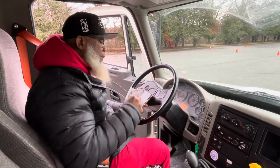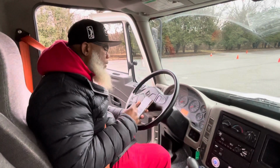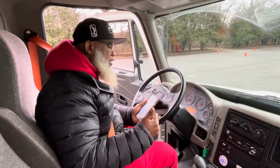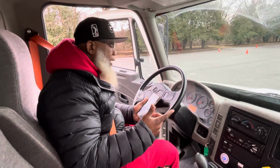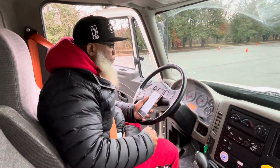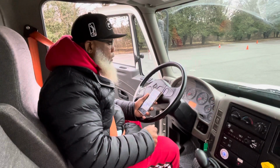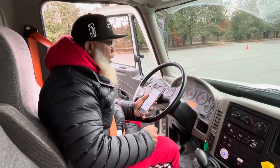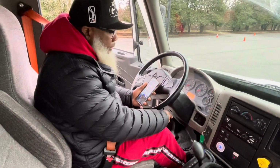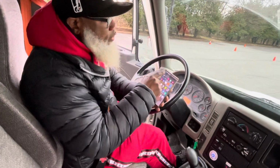While I'm waiting on my time, I'm just going to go ahead and explain my 3 emergency equipment. That's your fully charged ABC fire extinguisher, 3 reflective triangles, and spare fuses. All right. Now, we're almost at 3:57. A couple more seconds, and here we are at 3:57. I'll start it now. I'm holding my service brake down for 1 minute.